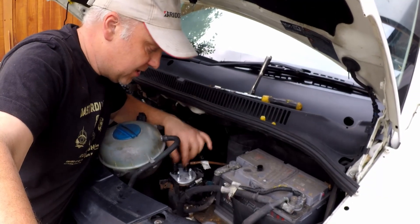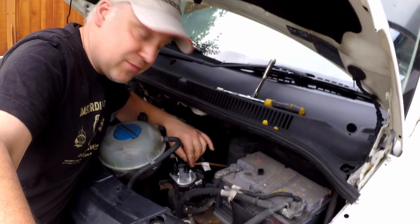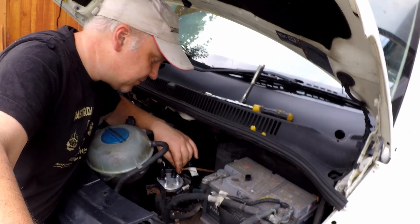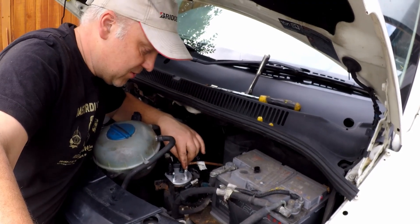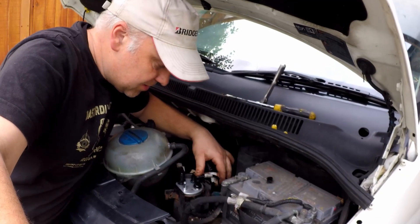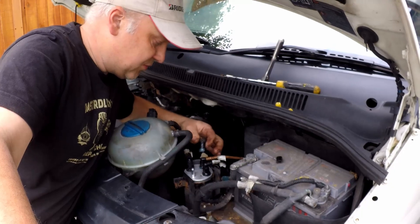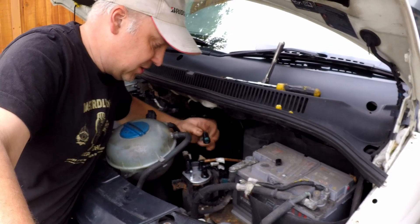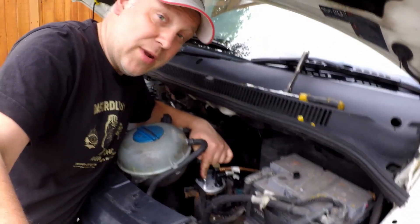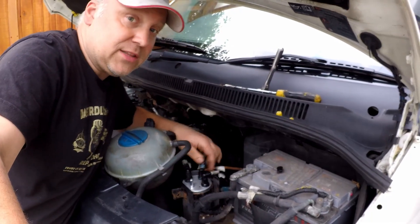It's always best to put some fresh fuel in there just to build up, because it takes a long time to prime. So if you're going to put some fuel in, put it into the supply which is VF. Or, alternatively, click it on, leave the return from the actual engine loose, and cycle the ignition a few times. Keep an eye on it and it should fill up nicely, and you can check the fuel pump's working inside the tank.